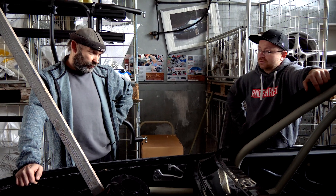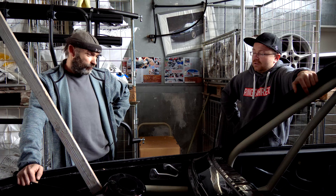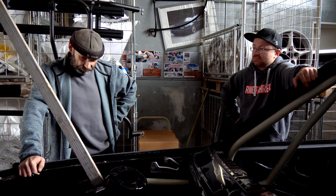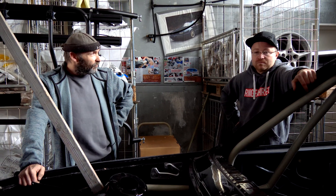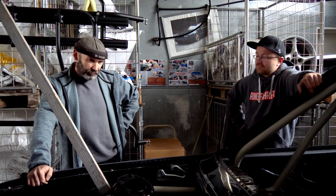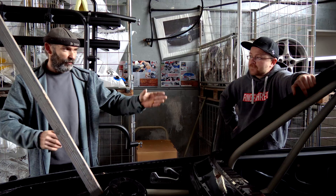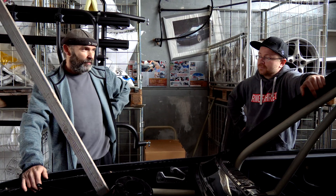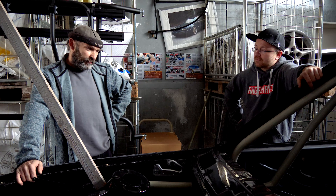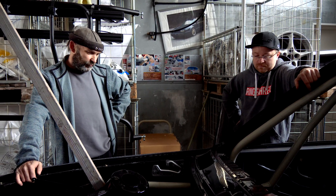For the sills and bumpers: René estimates the front bumper at around 4kg, rear bumper at 2.5–3kg. Sills roughly 1.5kg per side. Door panels are hard to estimate as they haven't been weighed — he's made them slightly thicker for the street version. For a race version a door would come in around 4.5kg including inner frame and outer skin.